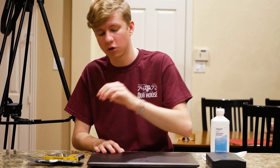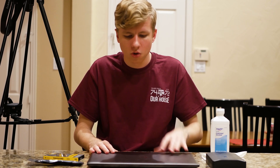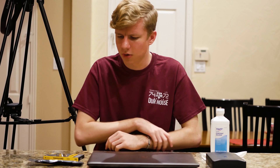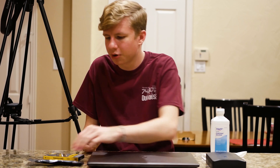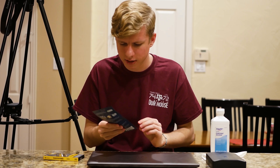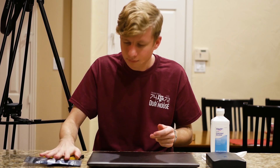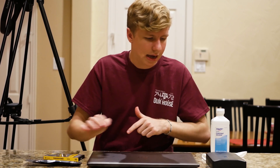What I am going to do is repaste the laptop. Thermal paste is a compound — a paste, really — that is put on top of a processor die, whether CPU, GPU, or whatever, and under whatever is making contact with it to cool said processor. The better quality thermal paste, the better cooling results you can get. The stock one hasn't been too terrible, but might as well upgrade. Here I have a brand new sealed package of Arctic MX4 thermal compound — good stuff, highly rated, eight-year durability supposedly. So those are the two upgrades: new memory and repasting.